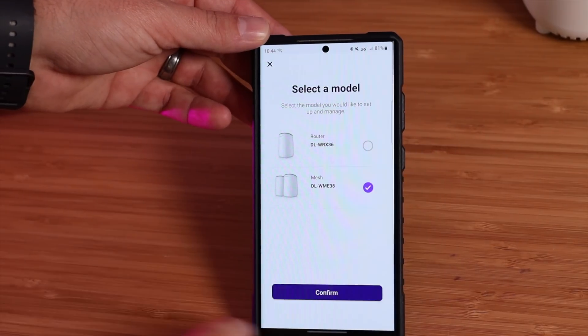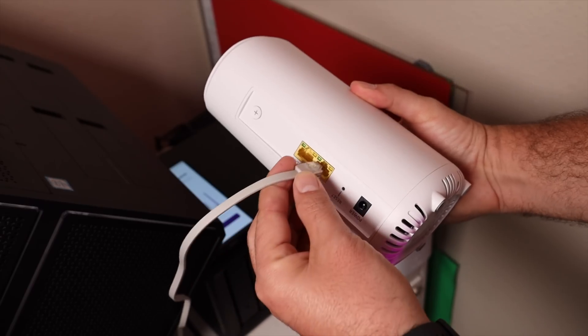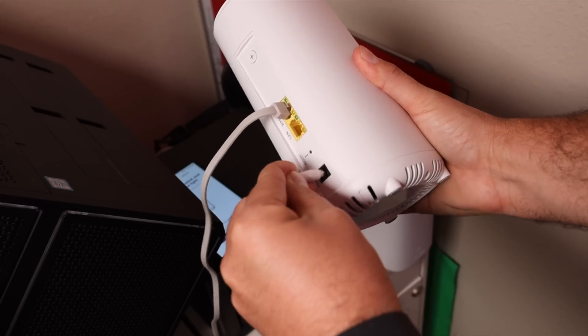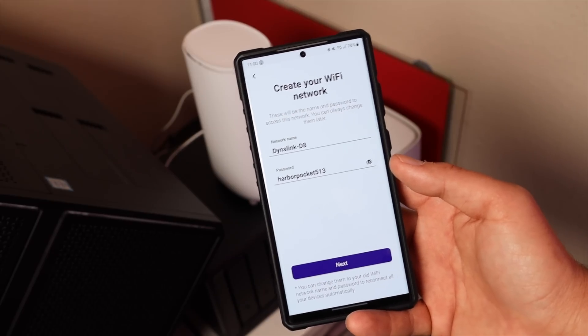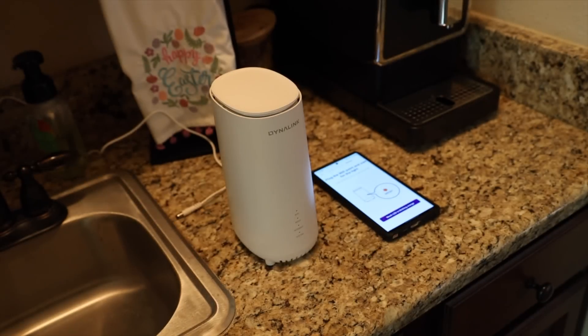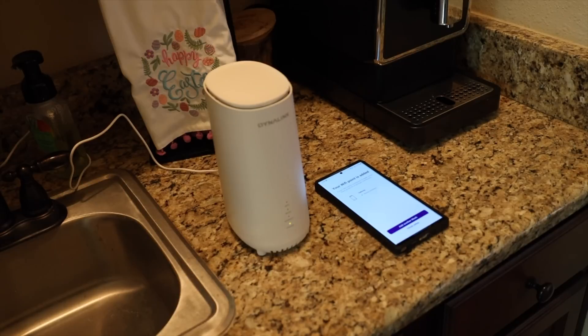To get this set up, we're going to select the mesh system and confirm. We do need to go ahead and unplug the ISP router. Next we'll connect the ethernet to the top port and then the other side to the back of the ISP modem. Then we're going to power up the DynaLink router. It's very easy to get your phone connected via a QR code, and here you'll be able to set up your own username and password for your network. Once your Wi-Fi name and password are set up, you'll go ahead and add the second mesh point. You should find a good central location — at least halfway between the original mesh point and wherever you're trying to reach. All we have to do is plug it in, and it just automatically added itself to the network through the application. Super simple.